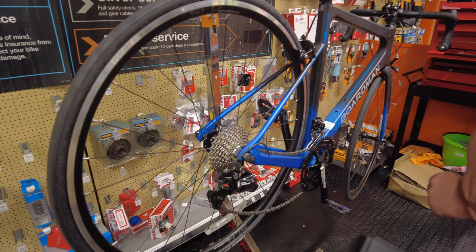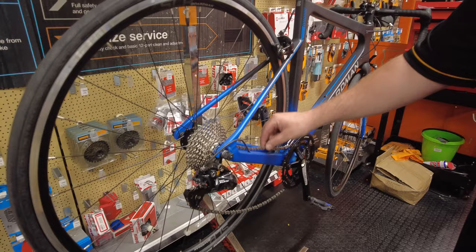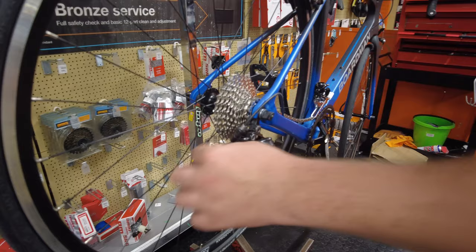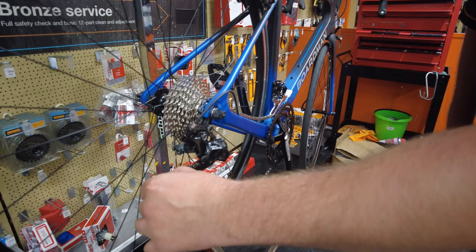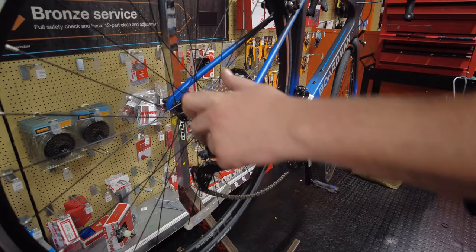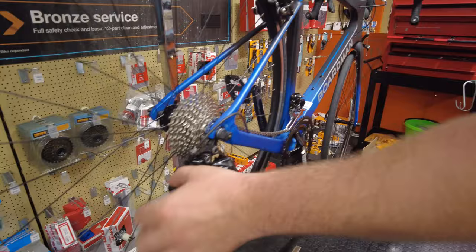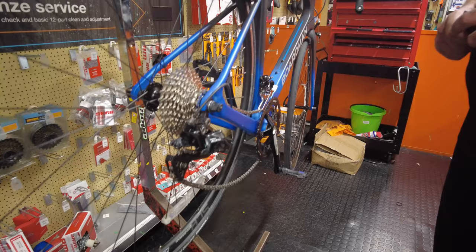I've just been riding it and I'm finding that the chain is skipping. Not too sure why — I'm not sure if this is normal on road bikes, but I'm going to take it to Halfords to find out. When I first saw the bike I could see the chain was sagging slightly, basically touching the frame — I almost thought the chain had come off. Under closer inspection it looks like the rear mech's B-screw isn't set right, so it's not giving the chain enough tension. In the smaller cogs it's just not going to ride well, and it could also damage and scratch the frame. You definitely need to make sure the B-screw is set up on the rear mech, which clearly it wasn't when it was boxed up.